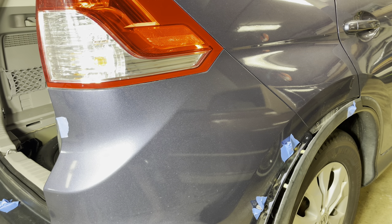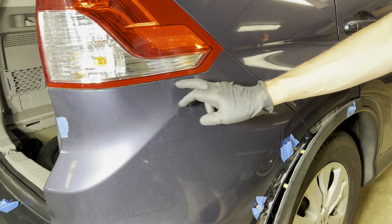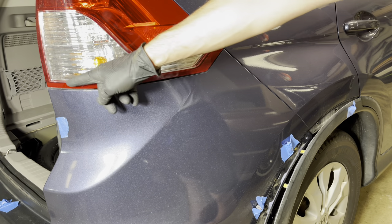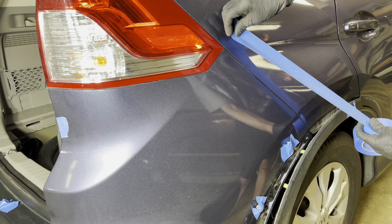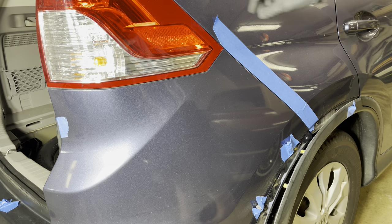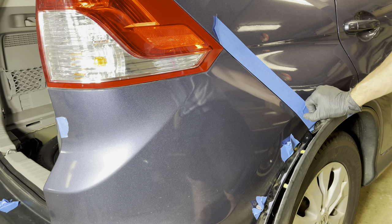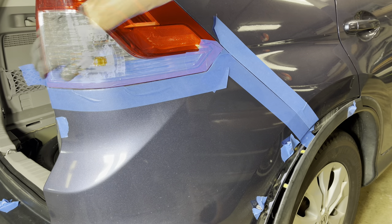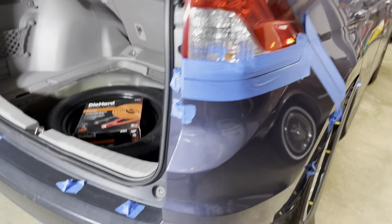This part I'm not going to mess around with — the Honda instructions for their trailer hitch mention to run some painter's tape along here, here, and on this side. Basically any seam that could be scratched when you remove the bumper. So I'm going to tape these sections off and just do what they say. I leave a corner folded under itself to make it easy to pull off, and just run my gloved hand right over the lip so the tape goes right over that edge. I'll get all that taped off on the passenger side and do the same taping on the driver side.